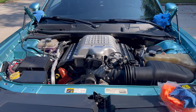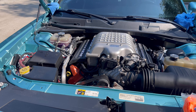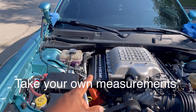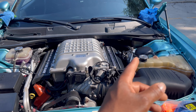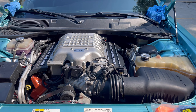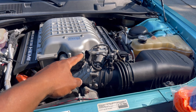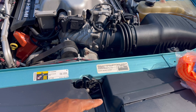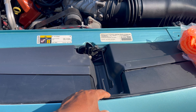If you don't know, the supercharger is not directly in the middle of the car — it's over to the left zone. So you're going to have to measure. It's like 22.75 inches on that side and around 23 on the other side. It's like 7 inches to the back measurement, and then 19 inches from the front of the supercharger to right here where the hood locks in or where the hood meets the seal.